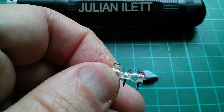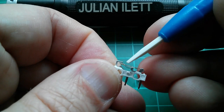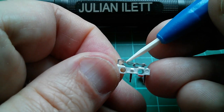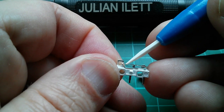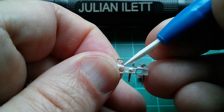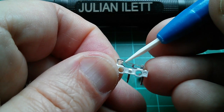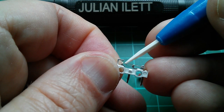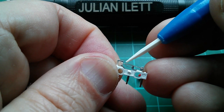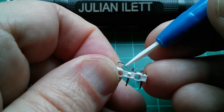It's very difficult not to knock the camera when I'm doing this because I've got about two inches between me and the camera. You can see the two contacts. This contact presumably comes up and goes over the top of the moving contact. I can move it with my screwdriver, and if I push it down I can make it come away from the top contact and touch the bottom contact, which presumably goes to that middle pin. This switch has to be break before make because it has to break from the top contact before it makes on the bottom one, so there's no way this arrangement can be make before break.